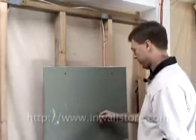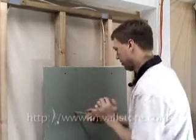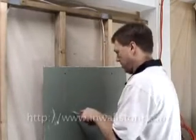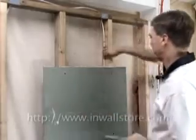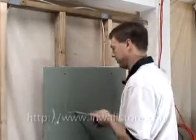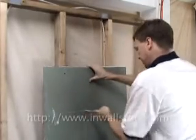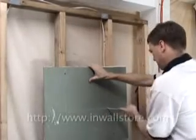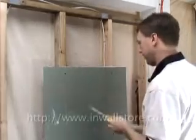So it gets to the hard part of cutting the drywall. We're going to start on one end. What I do is I go toward the stud, just kind of bang it a little bit to get it started, and then cut to the edge. When you get there, you know you're there. Over here, you notice I got wire coming down here, so I've got to be careful when I get close to that side. So I'm not going to go too deep. I'm not going to get too crazy next to studs when I know they're right there. Kind of feather it out like that, and we got that.